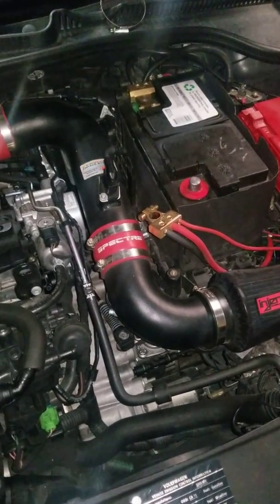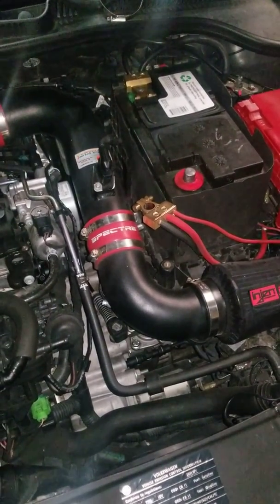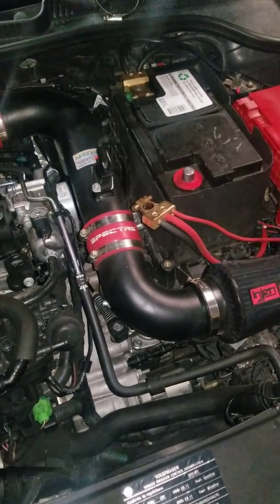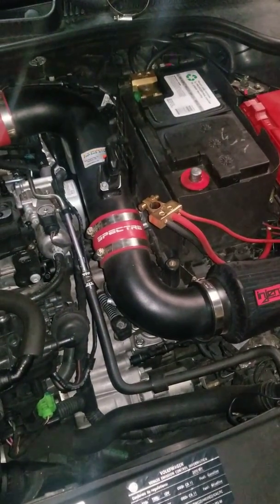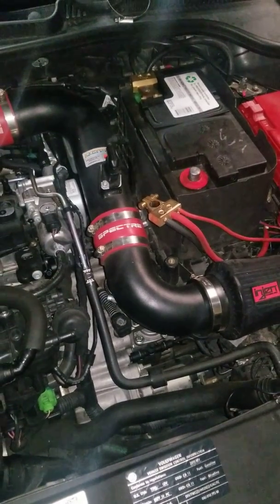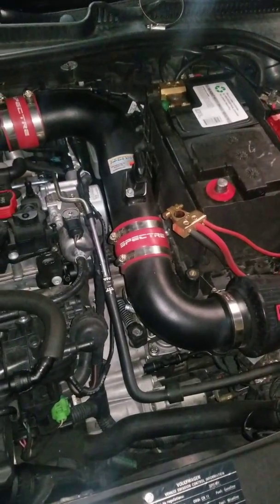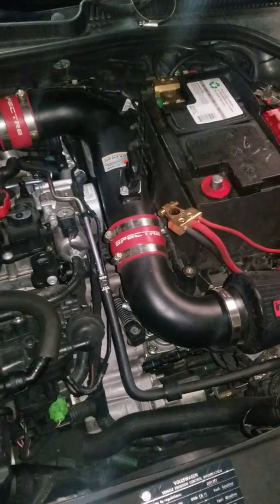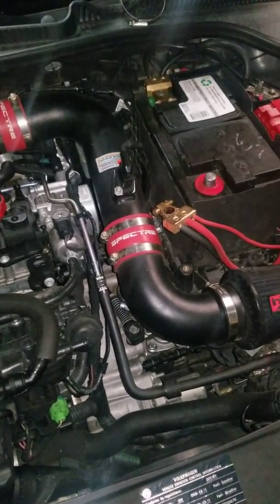You can even go a little over and be okay — like 14.1 or 14.2, I wouldn't worry about that. But if you start reading really high, like 15, that's a bad alternator, probably a bad voltage regulator. If it's too low, like around 13.3, that's most likely a voltage regulator that needs to be changed. Now if your voltage is inconsistent — bouncing around between 13.3, 13.9, 14, 13.7 — that means the diodes in the alternator are fried. Another reason to replace it.